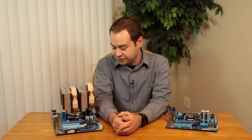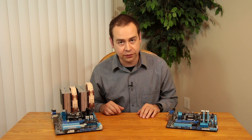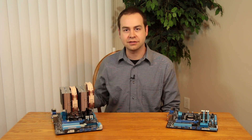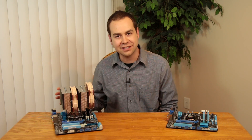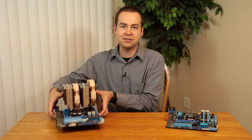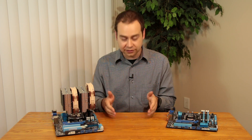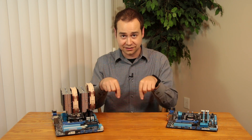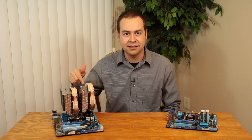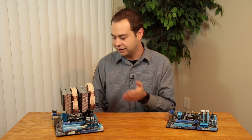Sandwiched between two different motherboards and a very large Noctua NH-D15, here are my first impressions. I'm really impressed with how easy it is to install this really big CPU cooler. I've wrestled with coolers half the size that were way more difficult — like that Zalman low-profile cooler for my home theater PC. This uses a really easy bracket on the back of your motherboard that you just slide on. All four mounts come through the bottom, you put down standoffs, slide on the curved brackets, screw them in, tighten two screws, and you're done. Getting this thing on and off is super easy.